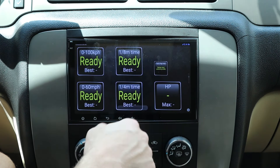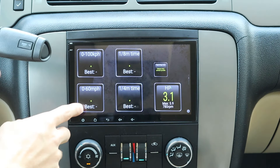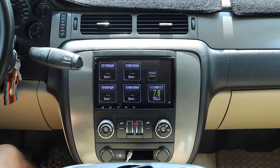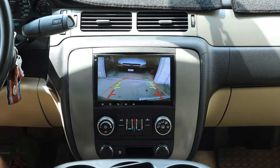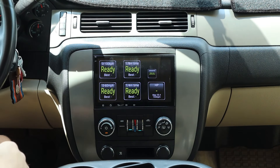What I'm interested to see is my fault codes. I have no fault codes as expected. This is telling me all my sensors. If you have an issue with emissions, make sure all your O2 sensors are working properly. There's also a zero-to-60 calculator that will automatically calculate when you drive.